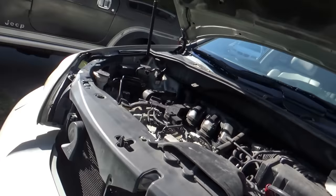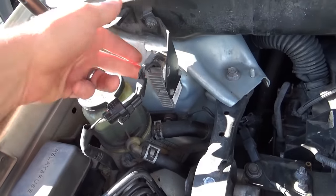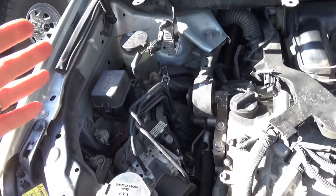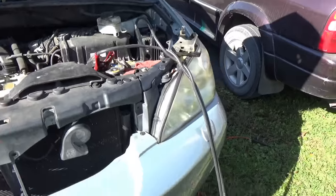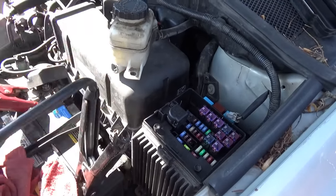And they said this resistor over here, a fuel pump resistor, was getting really hot. There are two speeds for the fuel pump, and we'll take a look at the wiring diagram soon. They measured it with a temp gun and it was like 400 degrees, so they weren't sure if that's correct or not. So we'll have to check the current draw. This is going to be current monitoring, seeing if there's a short circuit somewhere on this EFI circuit. So we need to pull up a wiring diagram and make a game plan of how we're going to track this current without blowing too many fuses, and see if we can pinpoint this issue.